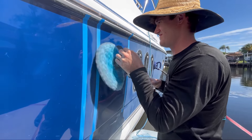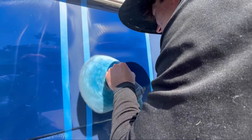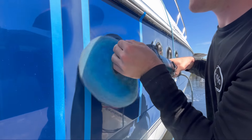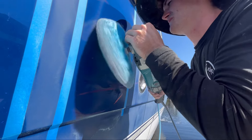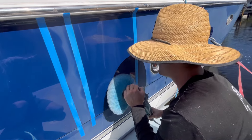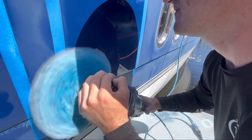We're taking it nice and slow, just as we did with Level R — at 600 RPMs, cutting nice and slow because this one is also a diminishing abrasive. What that means is your compound has heavy grits in it, and as those grits break down as you work the compound, they turn finer and finer, which turns more into a polish. That's why they call it liquid sandpaper — those thick grits start typically around 800 and break down somewhere between 1200 and 1500 by the time you're done. We'll increase RPM up to about 1000 and finish it out the same way as we did with Level R.